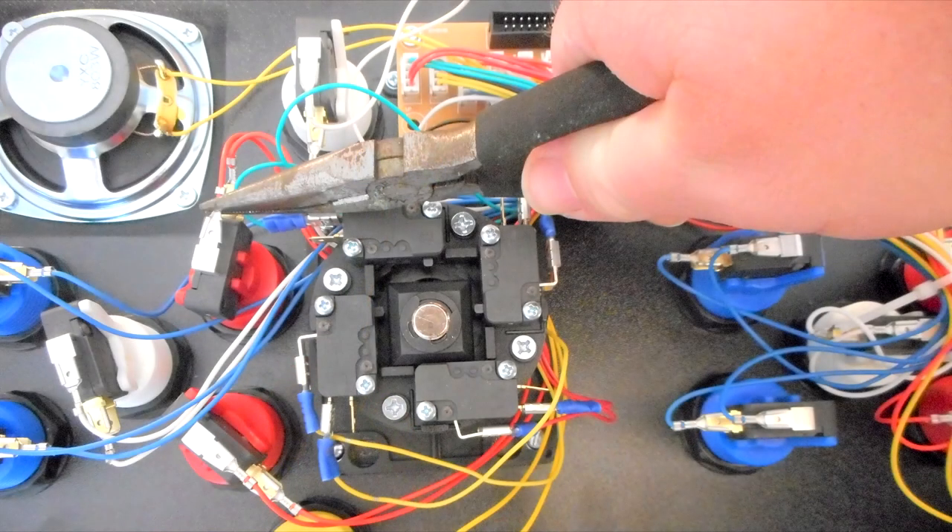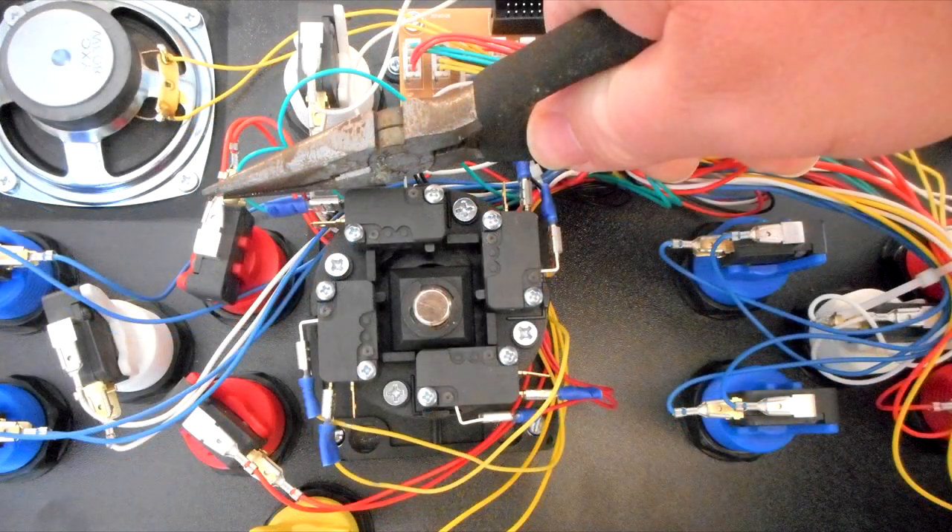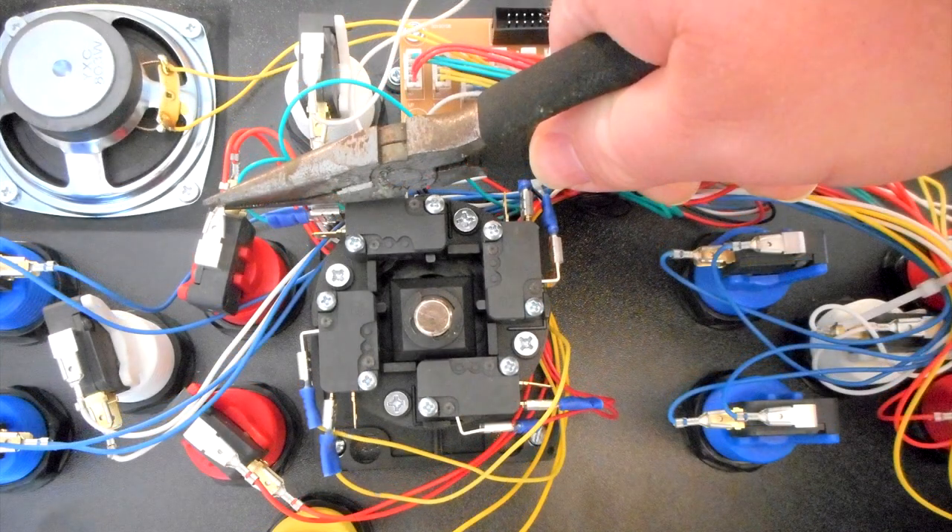I want you to learn from my mistakes: use your needle nose pliers to shimmy the old crimping terminals onto the new micro switches — it'll really save your fingers. You are going to have to force it on there to bend it, but it does bend. Just shimmy them on and they will go; you're not going to mess anything up.